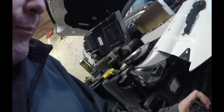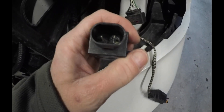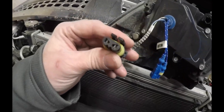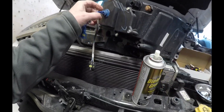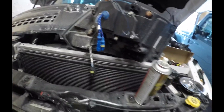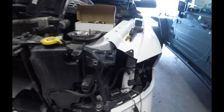I got them cleaned out a little bit. The contacts are a little bit cleaner — there is still a little bit of residue down in there, but I'm going to put some dielectric grease on that and a little tiny bit in here as well just to maybe get good contact. I'm thinking I lost the contact and the light actually isn't burnt out. The dielectric grease I have is a PG product, it's a sprayable can which is kind of nice.